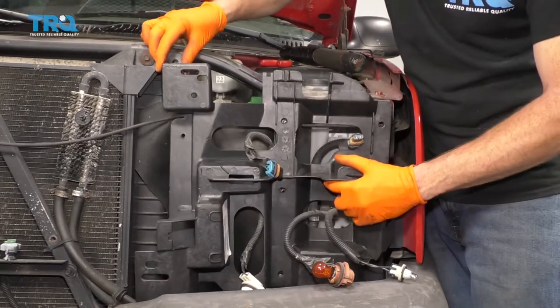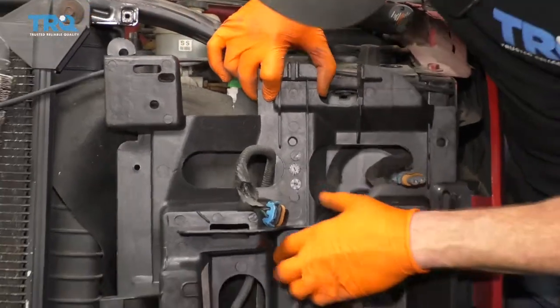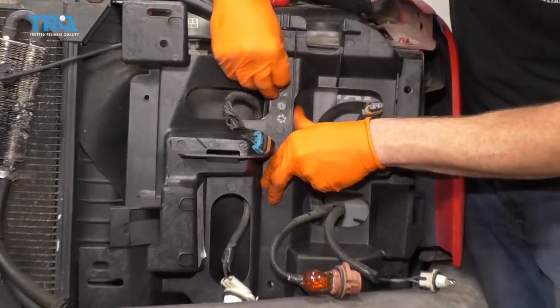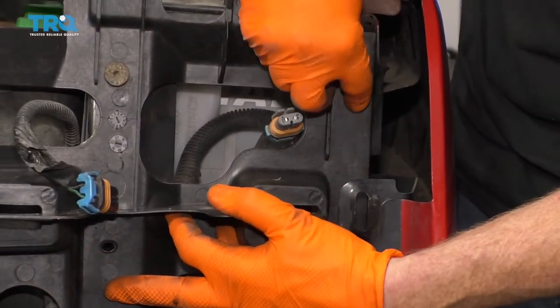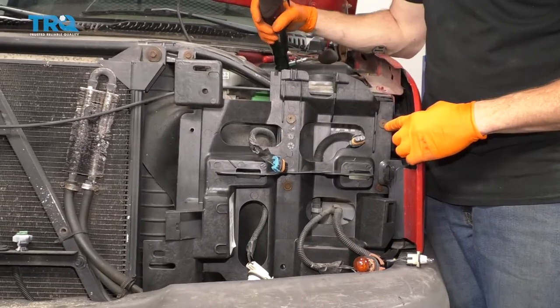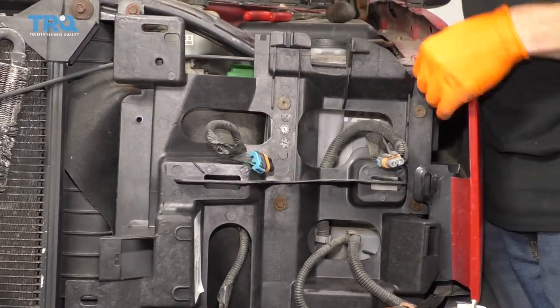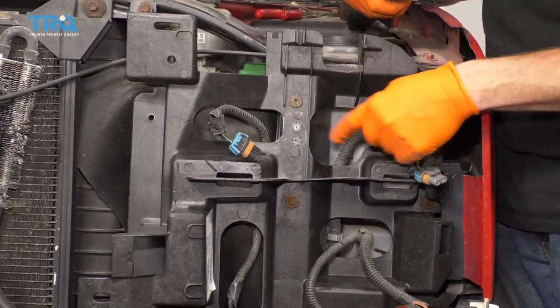Now we're just going to take our assembly and line it up with where it needs to go. Make sure you don't have your hood cable so it's going to get pinched or crimped in any way. Let's find our hole — there it is. Go ahead and start in one of those bolts. We remember that this one right here was one of the Torx bits, and this one right here was also one of the Torx bits. After that, go ahead and put in all the rest of those 10-millimeter headed bolts. Now it's going to be time to snug these up. As I'm tightening things up, I just like to make sure I'm not crimping anything. The last thing you want to do is pinch one of these wires between the plastic here and the plastic behind it — you could potentially cause some major damage. Now we'll just snug up the rest. Perfect.